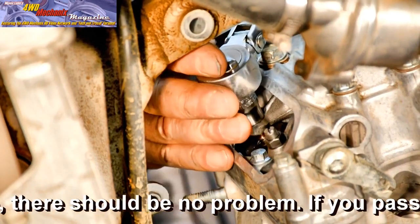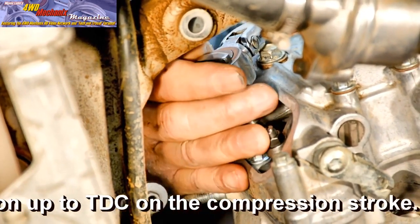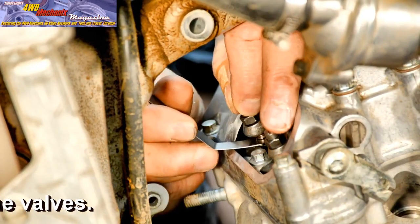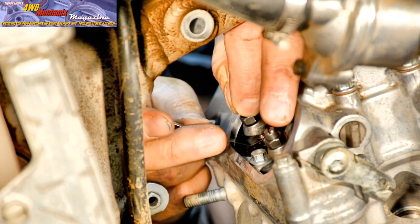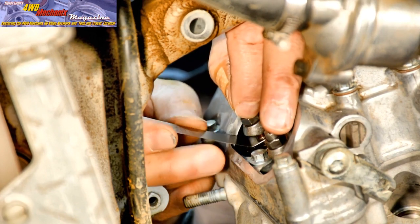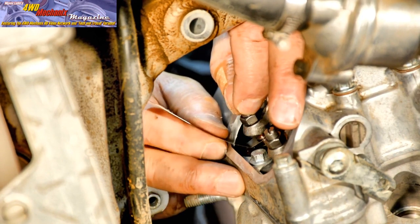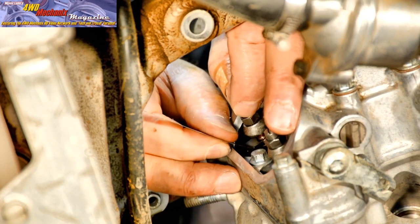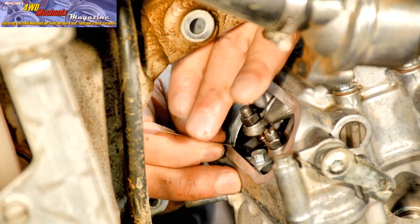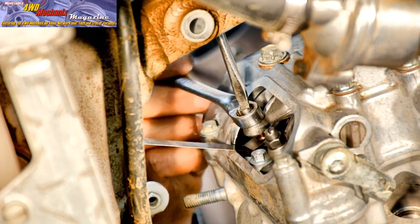The locknuts are tight, and the use of a ratchet and socket places rotational force on the nut and reduces the stress on the rocker arm and rocker shaft mechanism. Once again, the blade must be parallel to the valve tip and the rocker adjuster screw. Always hold the adjuster screw steadily when tightening the locknut. Expect that there may be some variation between the locknut tight and the locknut loose. It is often helpful to turn the screw slightly with the adjuster nut tightening to slightly tighten the adjuster to the blade.